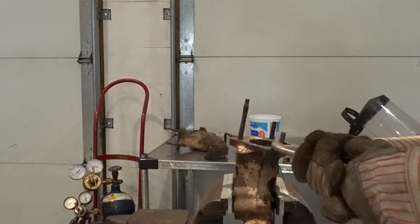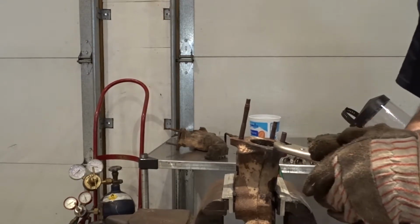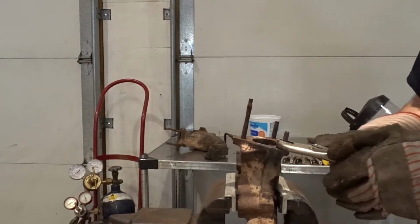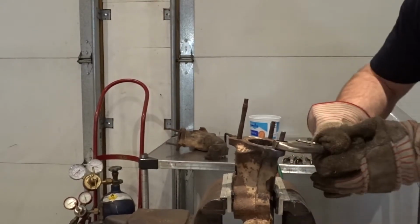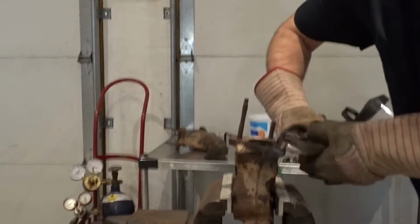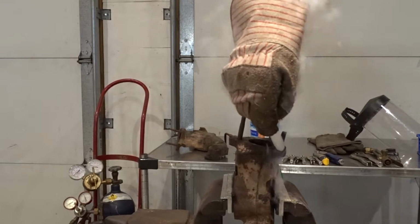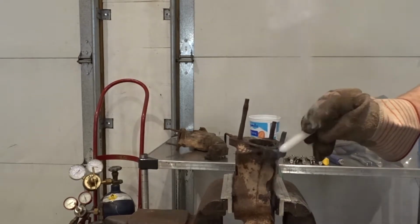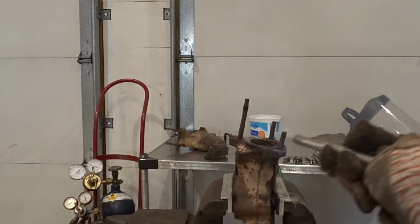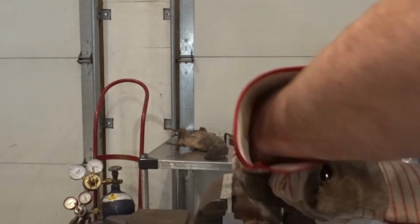Clamp down. Again, time is of the essence. And sometimes you might need to start. You hear it squeaking a little bit. Just work it back and forth. Come over here. You might want to get another bite. If you can, a little more candle wax in there. That just helps get wicks down in there and helps lubricate the threads.